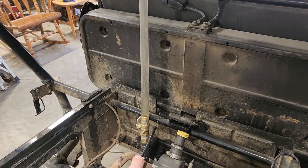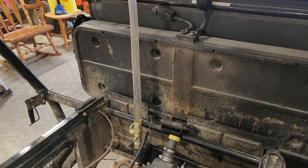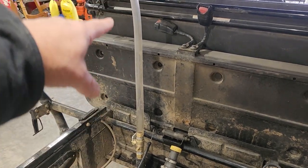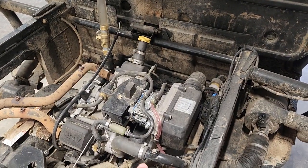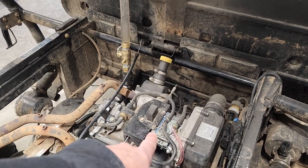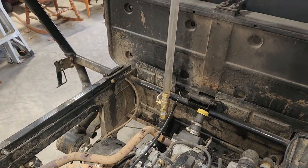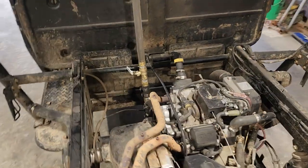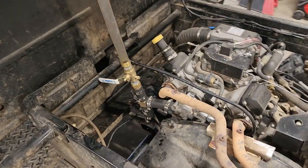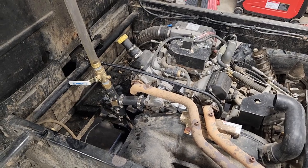The fluid just stayed in this clear tube, and then once the thermostat opened up I bled this off — as soon as I opened it, it just sucked all the fluid right out. It was unbelievable how much more air was in the system. I just kept this full, bled the system, closed the ball valve, reattached those hoses, and it worked like a dream. If you're having trouble getting your Mule to prime, maybe this is a solution. Good luck, have a nice day.